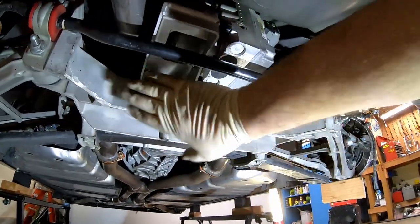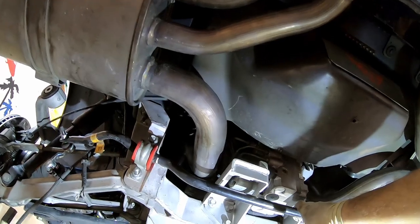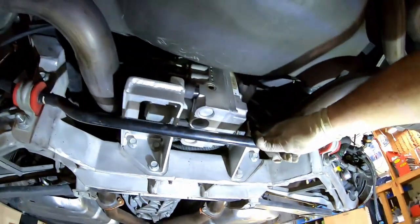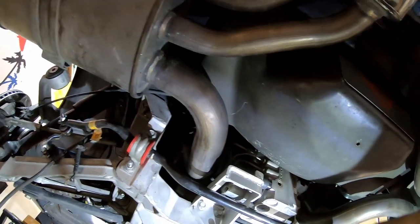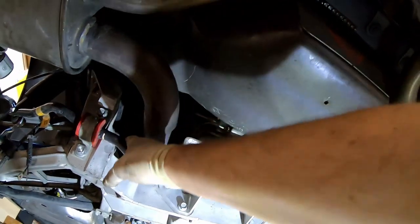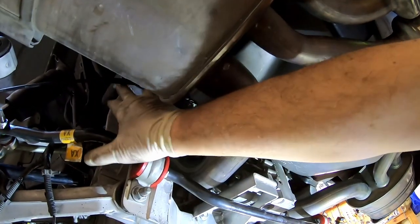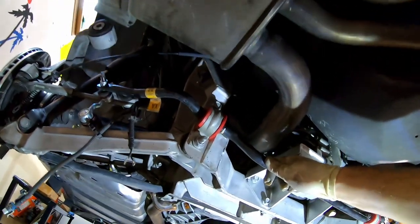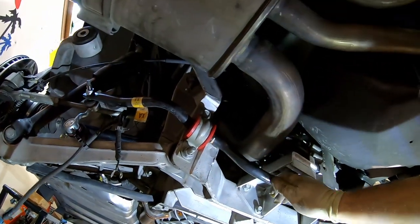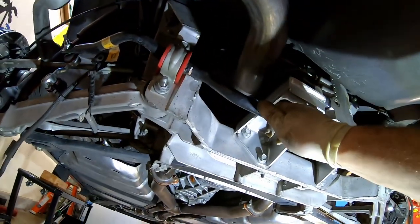Anyways, the cradle is all the way back up to the frame. Those get torqued to 81 foot-pounds. Like I said on disassembly, resist the urge to bang those back on with a bunch of ugga-duggas in the impact gun. That's not good. It'll break the rivet off in the frame that's holding the flag nut. Actually, it's not even a flag nut, because if it was a flag nut, it wouldn't need a rivet. But that's a story for another day.